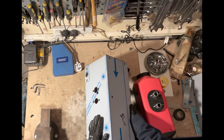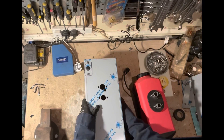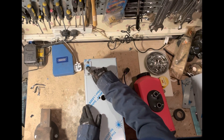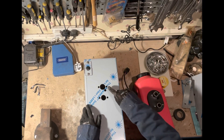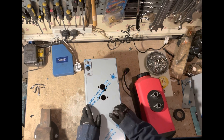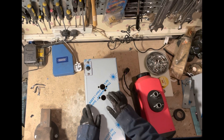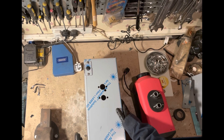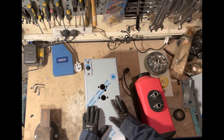It arrives wrapped in plastic fresh from being laser cut in stainless steel. On this side there's a plate cut in half which allows you to put your wiring in, and I've bought a half-moon grommet to go in here for the wiring loom to pass through. You've also got holes for your exhaust, air inlet, and the fuel line entry, plus the bolt holes to mount it up. I'm quite impressed with it — for the amount of stainless steel that goes into making this box I think it's well worth the money, and it's going to save me a lot of space underneath.